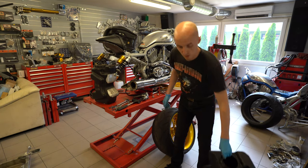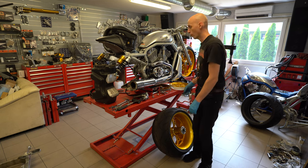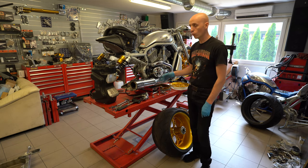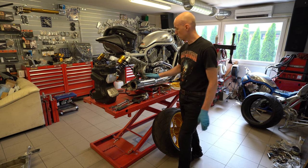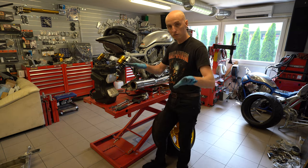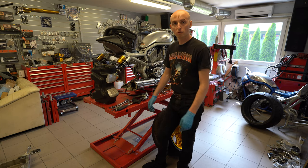What you do next is that I'm going to mark the place where I will cut away the frame extension piece, and when this is cut away, I will just quickly paint the edge, make sure that it's perfectly even. If needed, I will hammer it straight again, and back together it goes again.